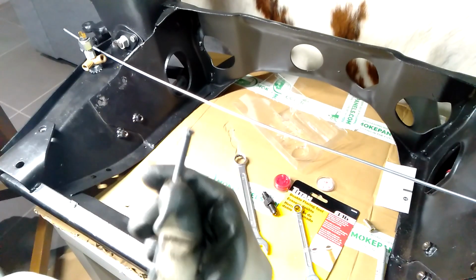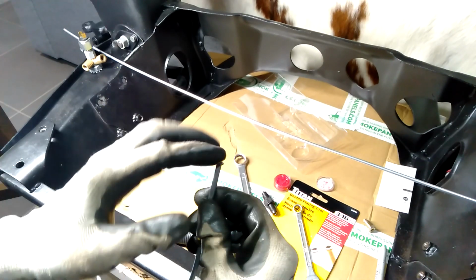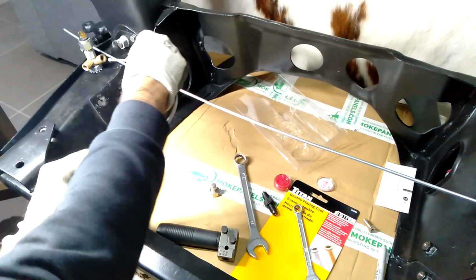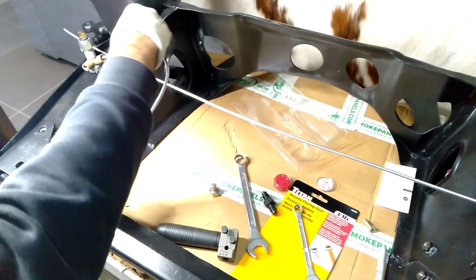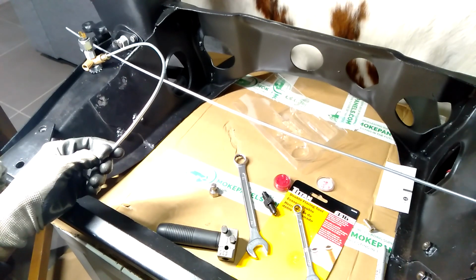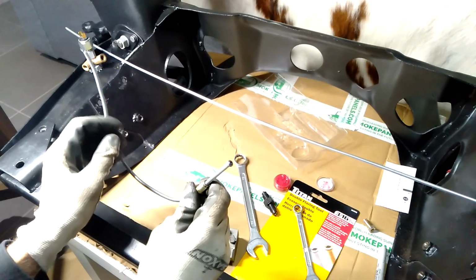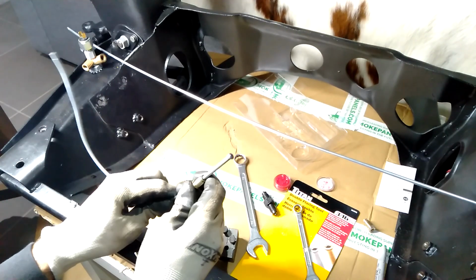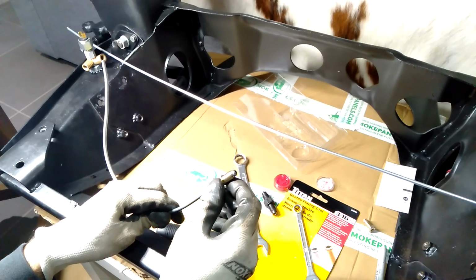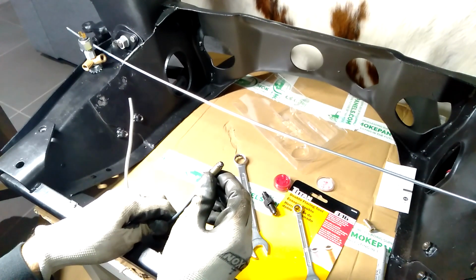I'll try and just get it a bit closer. So you notice the top of it is curved. The inside of these fittings is curved, so that will fit nicely in there once it bolts into position. So that will be the flare to use there. If you're using the female nuts on things like the rear hoses, the joiners in the side pannier, I think, you need to use a double flare.